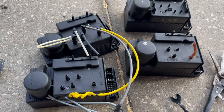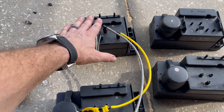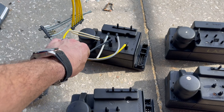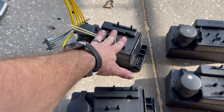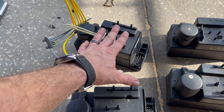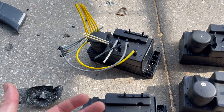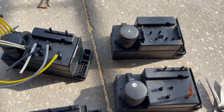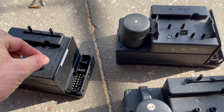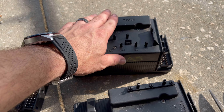Here is my PSE pump collection. I've got four pumps now — two I ordered off eBay recently to try to fix this CL600, and two came out of parts cars. This one just came out of our parts car and you can see I cut the hose lines to show you how to take those off. One big thing: take a photo of the top of your pump before removing it and note what you have. Now this pump I ordered throws me off — the male nipples are a lot smaller and none of the connectors would fit on it.